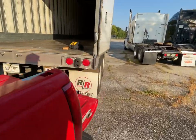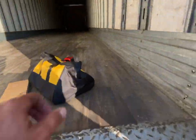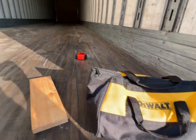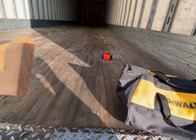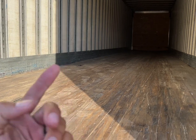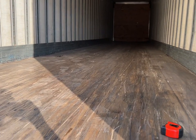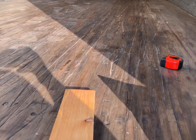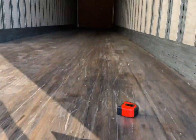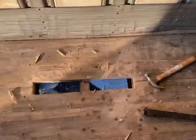Let's go fix the trailer. Got the good old trusty Dewalt multi-tool with the wood attachment, a measuring tape, and a piece of wood to measure and see if that's the size we need or if we need a bigger piece from Home Depot. We're going to cut from the bottom side so we stay between the cross members - you don't want boards not touching a cross member and have a weak point. This tool is priceless.